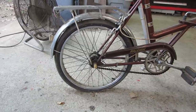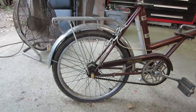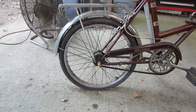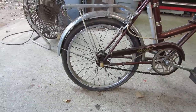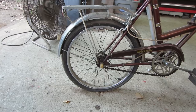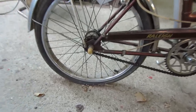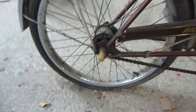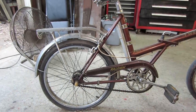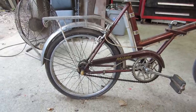Having said that, I'll probably put the single-speed rim back on this, or just leave it for parts. I got tired of trying to find a good back rim, so this one is going to donate to the cause. If you look at it, you can see the spokes are probably twice as many as what's on there. The other ones are about two inches apart; these are just over about an inch apart. When you ride the other bike you can actually feel the back wheel kind of lethargic and wobbling.